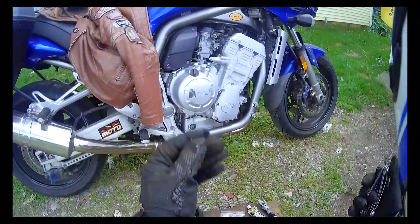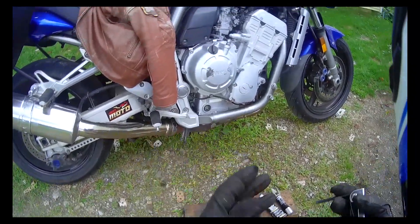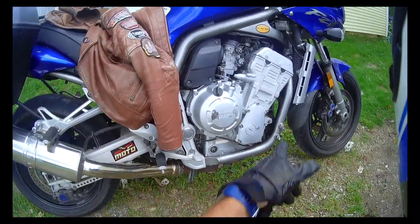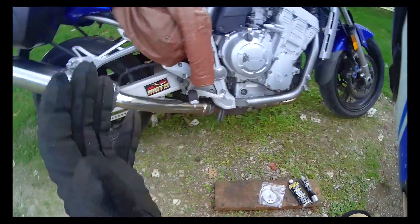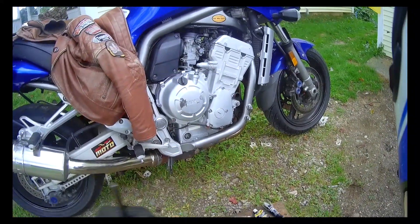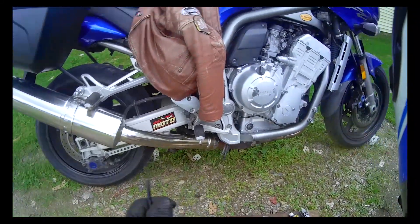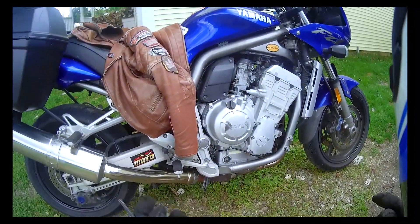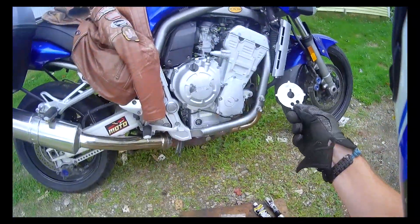The main reason people put these on — there's a bit of a controversy. Some folks say you shouldn't be putting an advancer on unless you have higher compression. Ivan from Ivan Performance, who is generally a great resource for tuning these if you're going aftermarket with more fuel and more power, shares that view. Instead of using jetting to correct the cold start problem, I found the four degree ignition advancer has really helped.